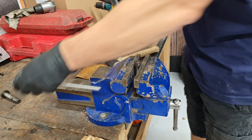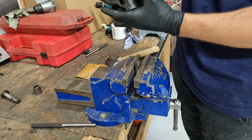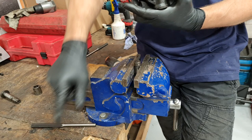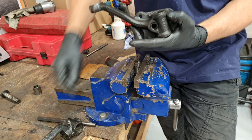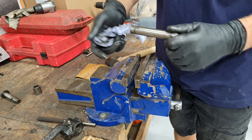We have our stub axle with our thrust washer on there — we need to retain that. We're going to replace the nylon bush in there as well. If your king pin is not tight into your hub then you'll probably need another hub assembly, because the king pin should be tight in this section and free to swivel in the bushes in the link pin assembly. There's our old king pin — I suspect all our wear was in our bushes as it was extremely tight to come out of our stub axle.